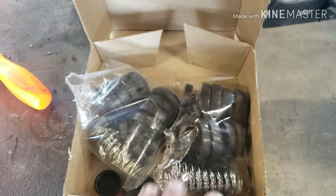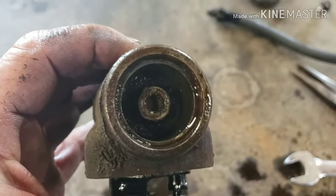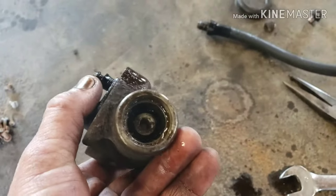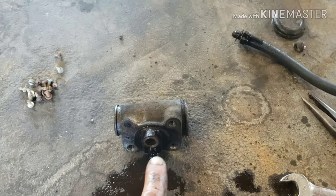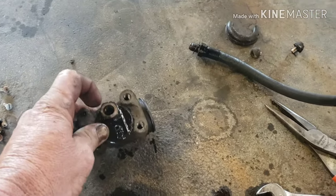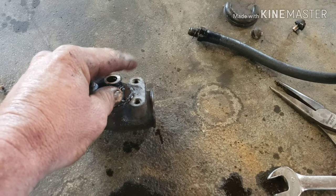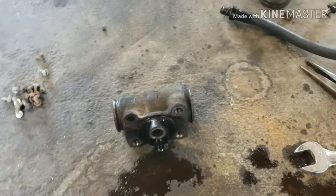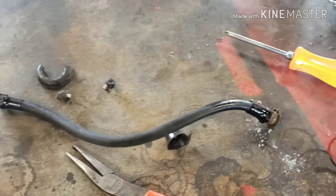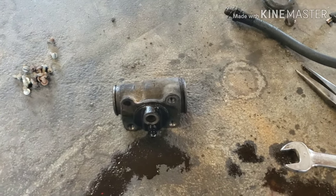Here's our rebuild kit for the wheel cylinders, because these were hard to find. Here's our wheel cylinder — took the boots off and the pistons are stuck in there, so we're gonna have to soak it and see if we can get them out. If we can't, I did find out that a 1940 Ford wheel cylinder will bolt right in. The difference is that on the International the port comes straight out, but on the Ford it comes out at an angle, so we'll have to get our brake hoses accordingly. We're gonna replace the hoses anyway, so we just won't have them made until we know if we can rebuild these or not.